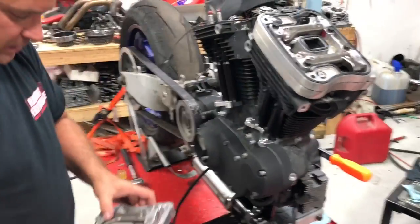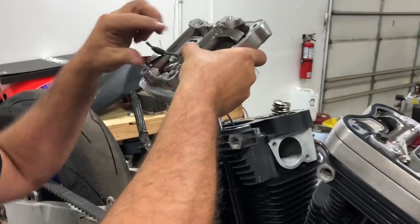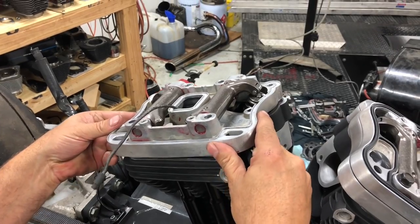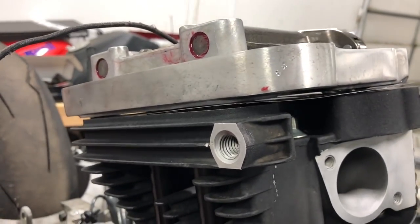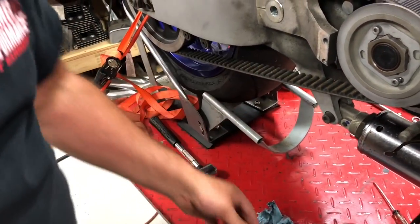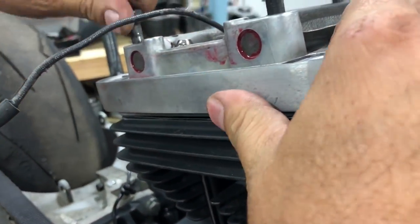So now we're able to take our rear assembly here, put it on the bike, and make sure you put your temp sensor wire through the center of it. Set it on your push rods there, get your gasket somewhat straight, come over here with blue Loctite, and set our four bolts in. Again, we're going to make sure we're in our gasket properly. Set that down.